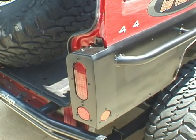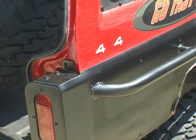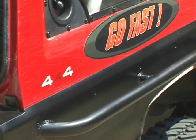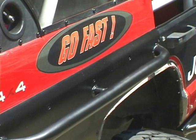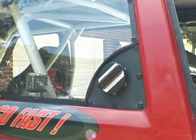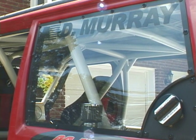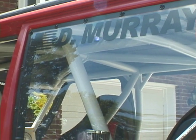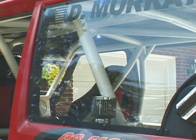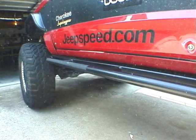This is the rear quarter panel armor — it's JCR's version with integrated tail lights and brake lights, all LED. There's a 120-wall, one-and-a-half-inch DOM coffin rail on there, all painted black to match. You can see the gas door has been elevated to keep it from snagging — it's now up in the window area. The rear windows are quarter-inch Marguard number 10 and are also removable, though you probably wouldn't want to.